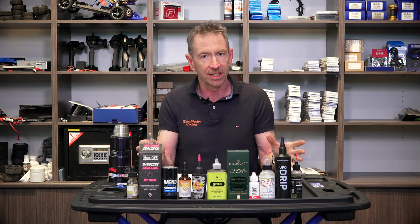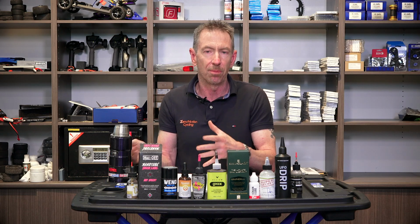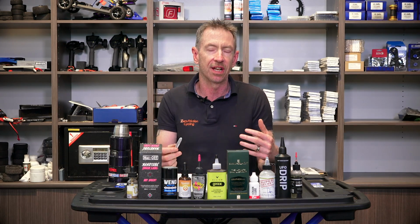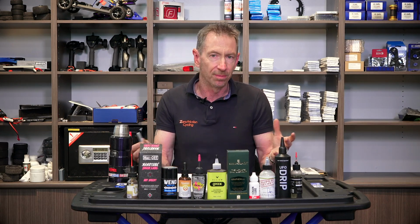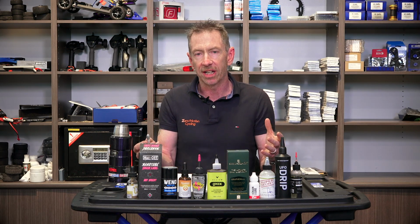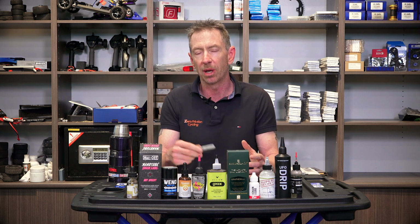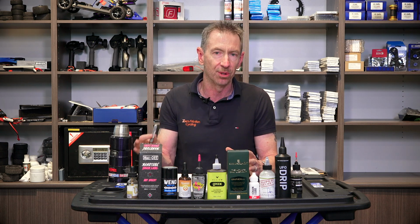So things look nice and clean, and it's pretty easy to check because we get customers who've bought a new bike, they'll put the bike on Strava so we can see how many kilometers it's done very easily, and we get a person with just normal, recreational cyclist power, riding only in dry conditions, and after say 3,000 kilometers, their chain is well over 1% wear. That's just not remotely near a good lubricant.